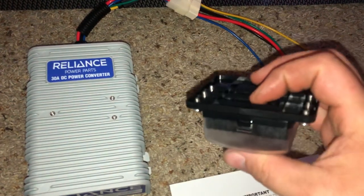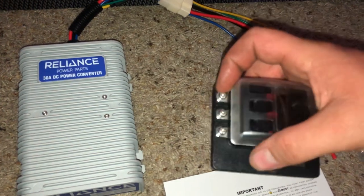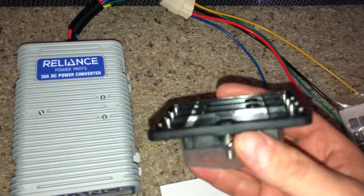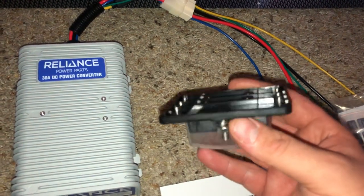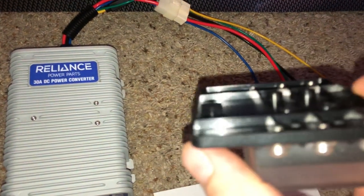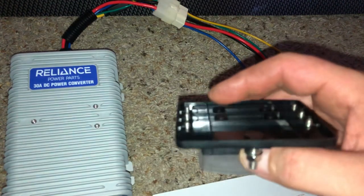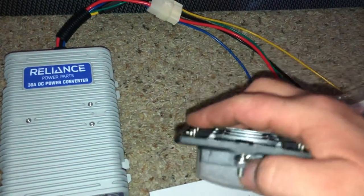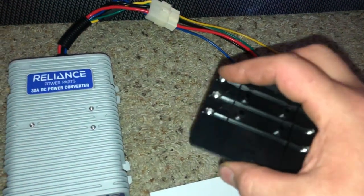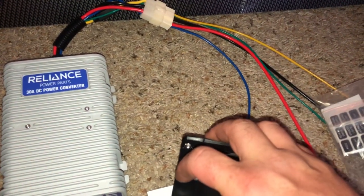Beware — if you buy this, I noticed there are screw terminals, which I wanted rather than spade terminals. But they're bare at the bottom, so if you would mount this to something metal, it's pretty close. It might be hard to see, but if you screw those down any tighter, it would get real close to metal. So I'm probably going to take some hot glue and hot glue the bottom of these, and I may even mount it to fiberglass so I don't have to worry about it.